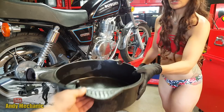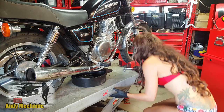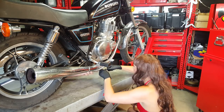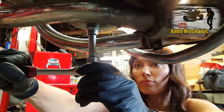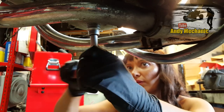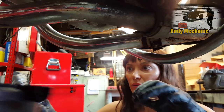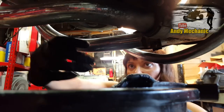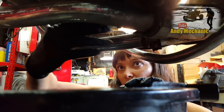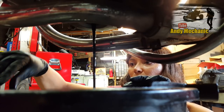Okay, you're going to need that container to drain all the oil into. Pop it just under the sump. Crouch down a little bit. Can you see that bolt just under there? If you just slack that off two or three turns - it's going to be reasonably tight. Then take the ratchet off and give it a twizzle by hand. There we go - that's loose. Pop the container under there and keep going. You're going to get oily! And you can sit the bolt on the edge. We'll give that a minute or two to drain off.